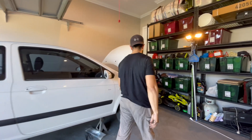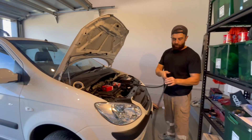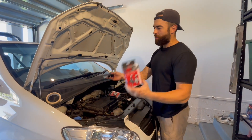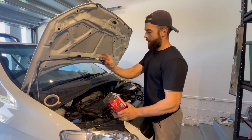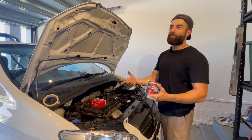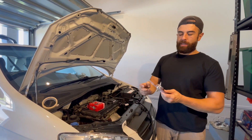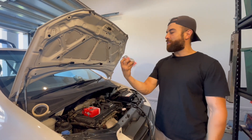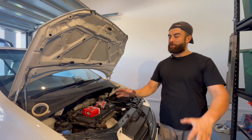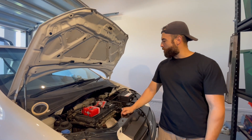The fuel feeds have been run to the front of the engine bay. It's always good to mark them. I'm going to be running this fuel pressure regulator — this was $79.99, used it before, it's pretty decent. You can get them for $20 or for hundreds of dollars. Budget matters. We need to dial in the fuel pressure; we're going to go for 45 PSI, make sure the car is running nice and stock.